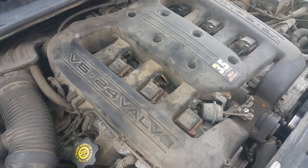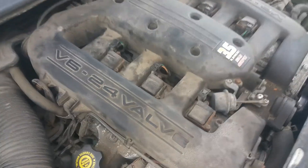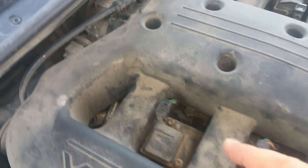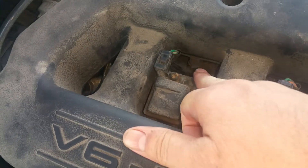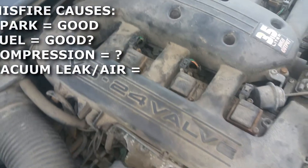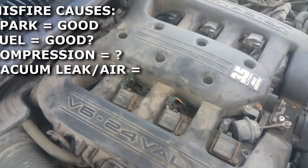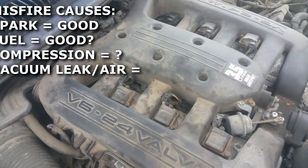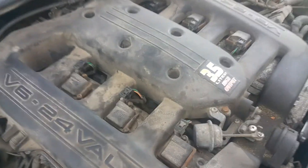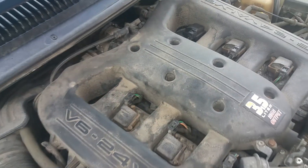What's left to check is fuel, air, and compression. Fuel is tricky because the injectors are buried in there, but I put a stethoscope on it and it does click, so I'm going to rule that out for now. I don't have a compression tester, but I was going to test compression by bleeding into number five.